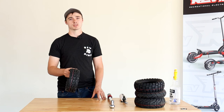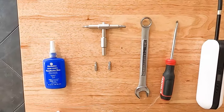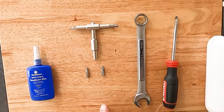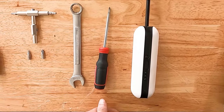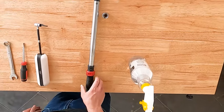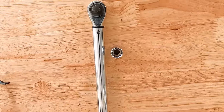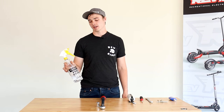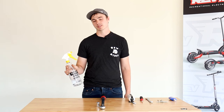If you've got any more questions on the tires, just leave it in the comments below. For tools today we're going to be using Blue Permatex Thread Locker, our Fix-It Sticks with the number 4 Allen and number 2 Phillips, an 18mm end wrench, a flat screwdriver, and an air pump. Optional tools are a 1/2 inch drive torque wrench and a 17mm 1/2 inch drive socket. We also have some soapy water and a spray bottle, which will help us get the tire on and off the rim on the 1000 watt version of the 10X.